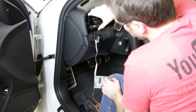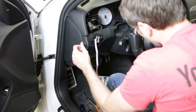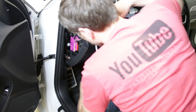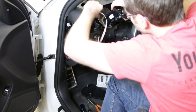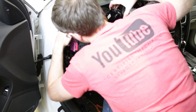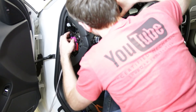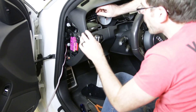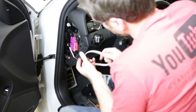Our gauge is set in place and plugged in the vehicle. We have the wire hanging and need to get it fed down so we can get it plugged into the OBD2 port. We're going to start by removing this trim piece on the side of the dash so we can run the wire down. We'll pull this out, get it fed down, and pull the slack through so we can get it plugged into the OBD2 port and get the entire assembly mounted back in place. We have it fed around the side here and we can feed it down from there.